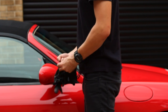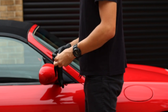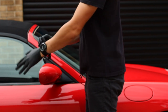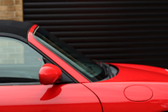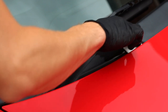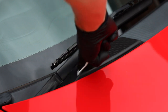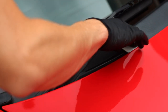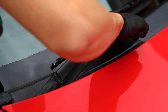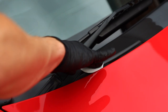I bin the gloves because they're too big for me, but I can't recommend enough — if you're using a coating, throw some gloves on: black ones, blue ones, any colour you want, as long as they fit they'll protect your hands. Now, on with the coating. Put a small amount of product onto one of the cotton applicators they supply and just start working it in. It should be a really easy process because you've put in so much work to prepare the surface, and instantly you see that transformation happening before your eyes. Porsches of this era are known for bad trim fade, hence why I've done it on this car.